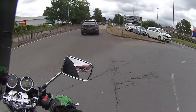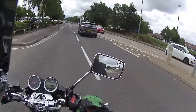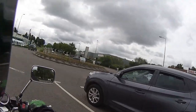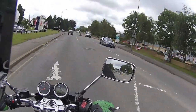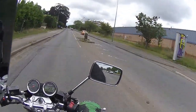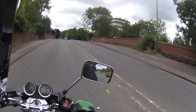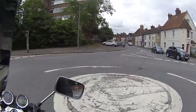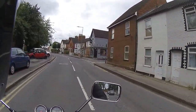I do like the sound of an exhaust that crackles a little bit. It's got some instant power there, and it tracks perfectly through the corners. Apart from that little annoying rattle — that's one of the fairings rattling on the clock, so I'll get a bit of foam in behind that, or get it re-bolted up. That would annoy the hell out of me. It's only when you're at a certain rev range that it does it. Otherwise, all good.